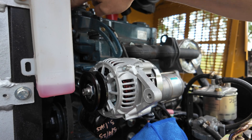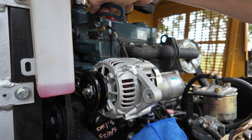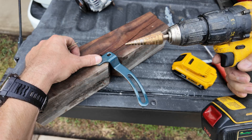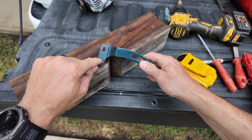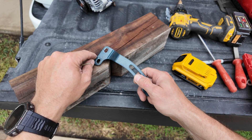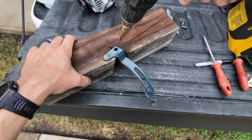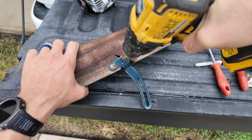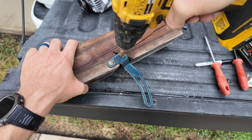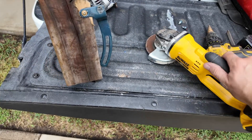I might need to do a little notch on the top as well, because on the actual water jacket up top it is going to get into that. A little shaving here and opening up this hole — I think that'll be the ticket. The best way to oblong it out to gain that extra height is just to use a step bit. There is a little bit of movement already, but I need at least an inch, so I'm going to oblong the hole and then use a file to finish cleaning it up.